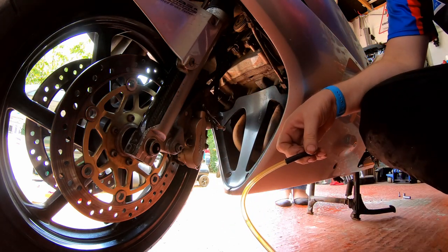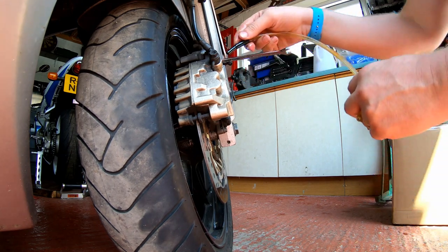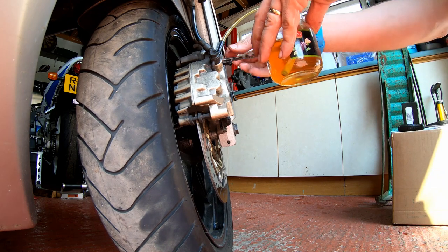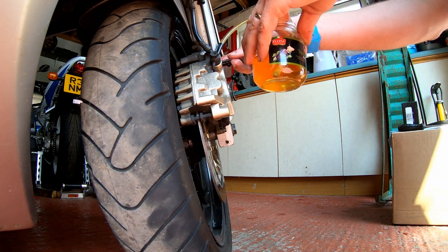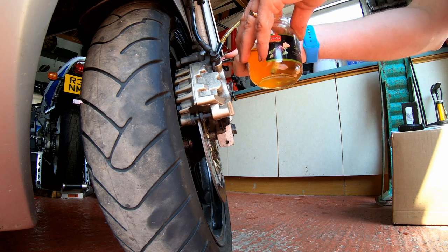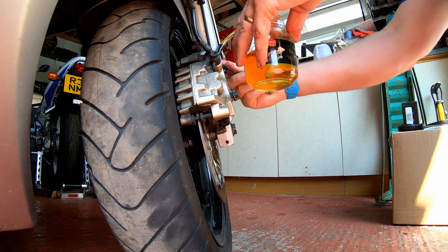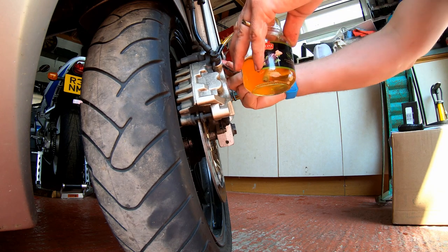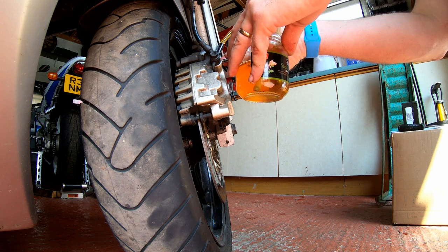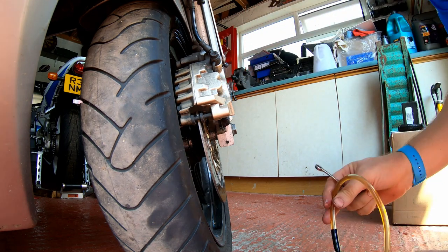So next, over to the right hand side. Okay, pump the lever about 5 times and then hold it in. And out. In. Out. In. Out. In. Out, then in one more time, and out. Okay, so that is both the front lines done.